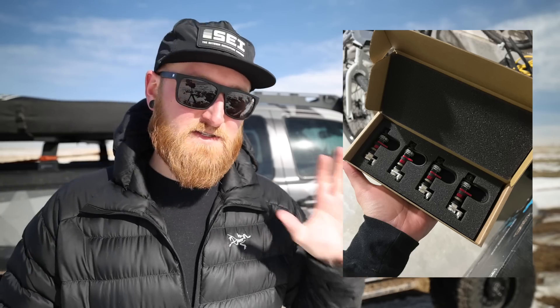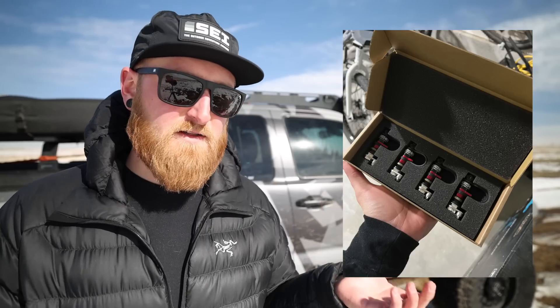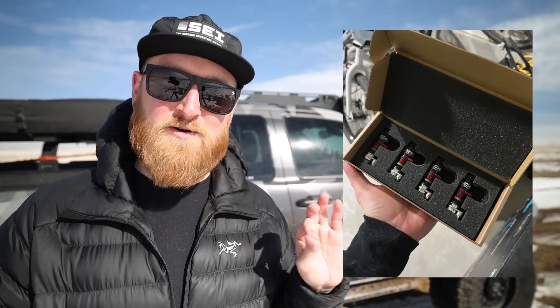One of the fastest — but not the absolute fastest — ways to air down is the Fasterflate. The absolute fastest way is with some more hardware like these Apex valves right here. I don't have these installed currently, but if I change out my wheels and tires in the future I'll install these. Airing down is almost too fast — you simply pull up on the valve, it deflates insanely fast, then click it back closed once you're at your desired pressure. The main downside is they're so fast that without a digital gauge you could go lower than intended, but once you get the feel for it it's maybe five seconds per tire.